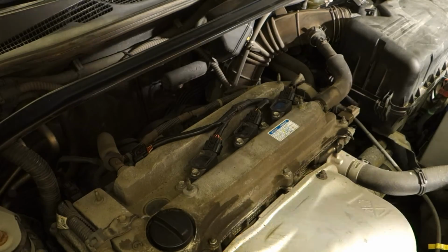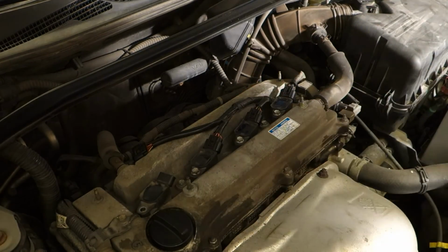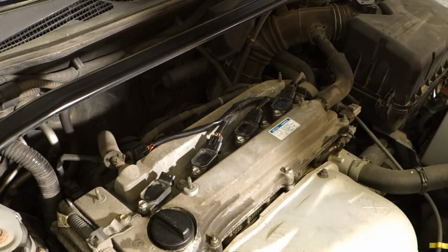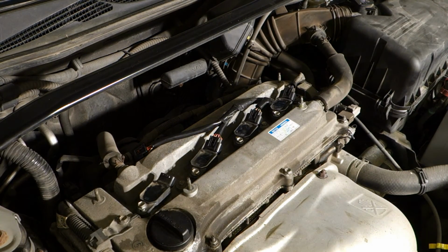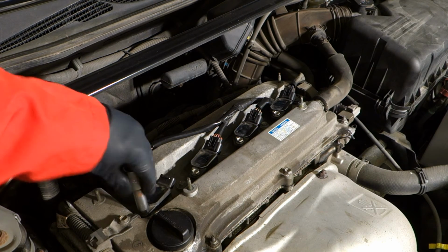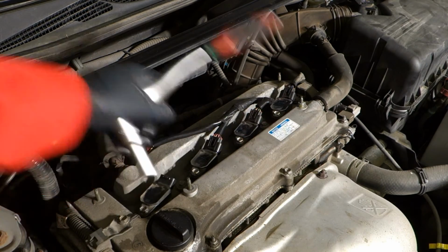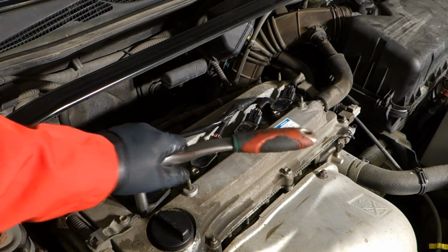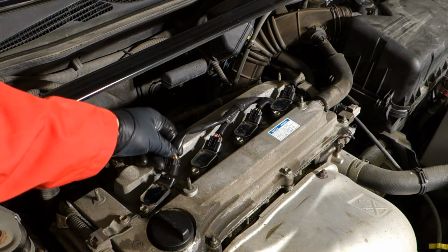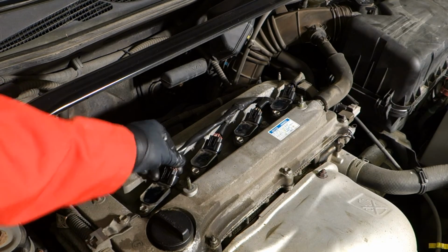and the final part is to install this ignition coil back in here in that way, and then this bolt, what was this, 10 millimeter in here, and here is my 10 millimeter socket. And first I rotate that in this way, and then I use my tool, and the same in here also. This is plastic, so not too much force, because we can break it. So much that this is tight and this coil is not moving. And the final step is to insert this cable back, and we must press it so that we hear this click. Okay, now it's okay.